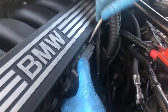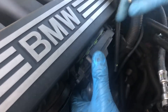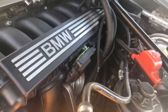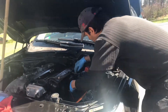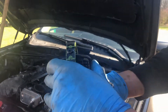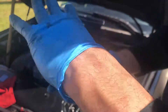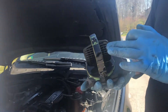That's kind of like a little O-ring there. See that O-ring? That's going to be a vacuum leak right there. Let me catch it on that little bracket right there. I may have to order a new one. Watch out for the screws there. This little bracket right here is in the way - I'm going to have to take that off. It's stuck. Is that supposed to be free-flowing? It's supposed to be - it's a flap. That's your problem right there. This thing is staying open the whole time.